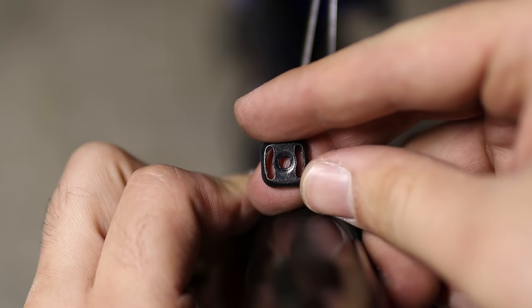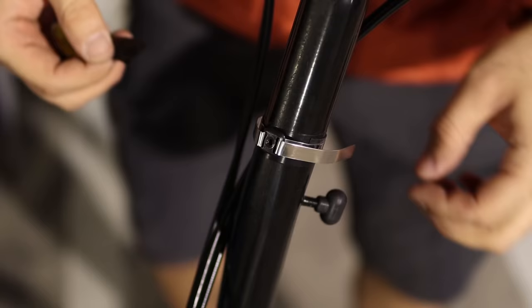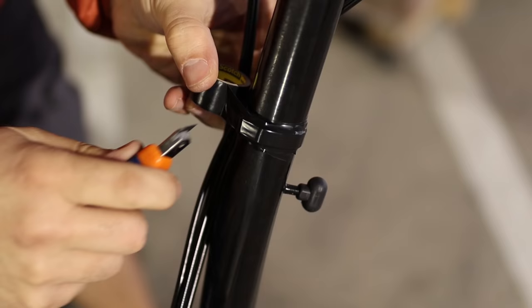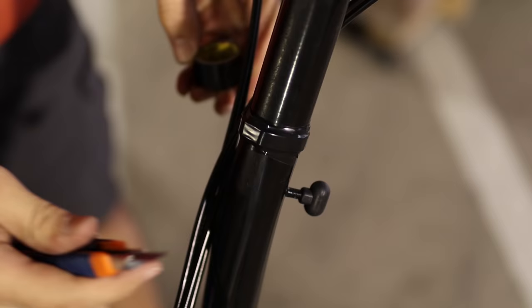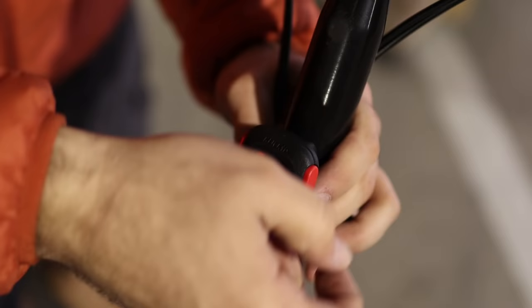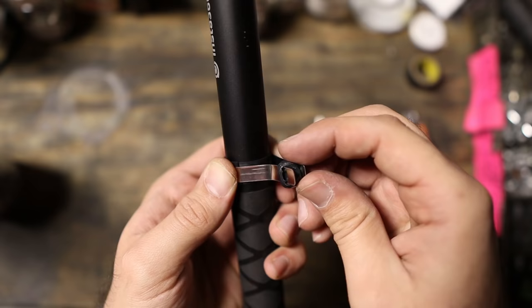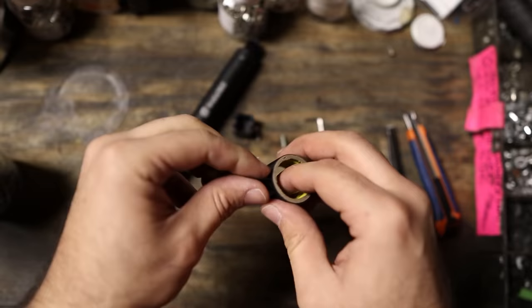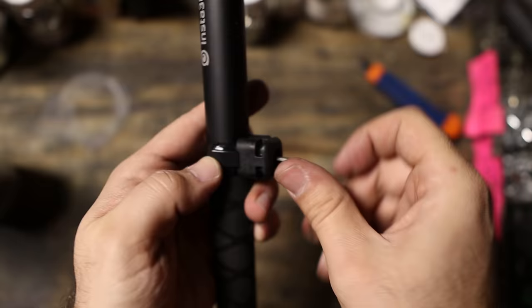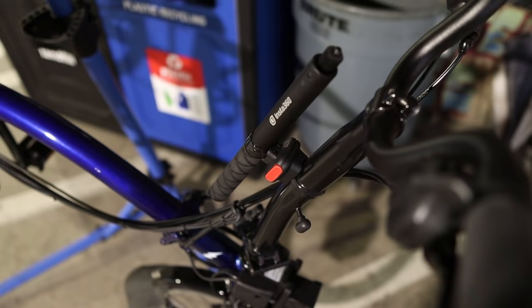This metal strip goes around the stem through this metal clip and we fold it back up. I like to roll some electrical tape around it to make it all black, but it's a personal thing. Now we install the actual mount and use a bolt to lock the mount to the steel plate. As we tighten the bolt it tensions the steel band and locks everything into place. Here it is installed on the selfie stick that I use with my 360 camera.